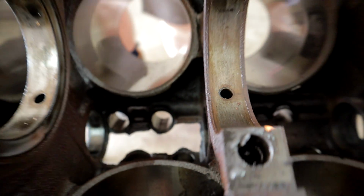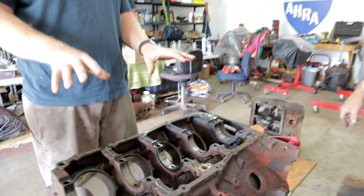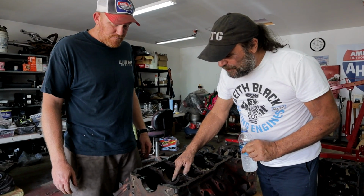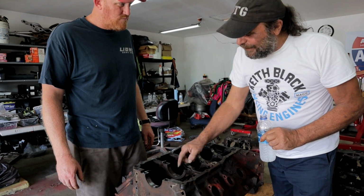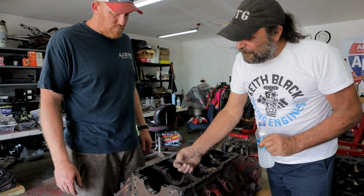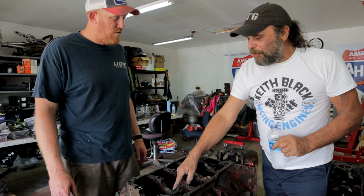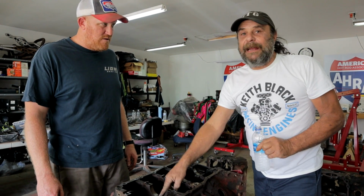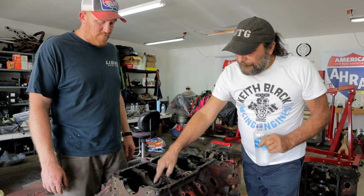Right, and I still haven't figured out why every single one I put together is always off. You're thinking, man, they're all off about the same amount. Why didn't you just adjust the tooling on it? They did the same thing on the FEs, where it's off front to back instead of off to the side. And the oil hole is half covered by the bearing. So chamfering that is a big deal if you're going to detail one of these blocks ready for a build.